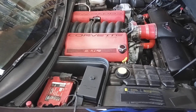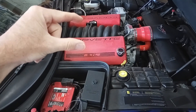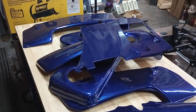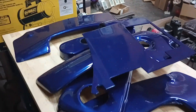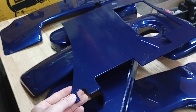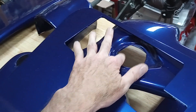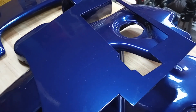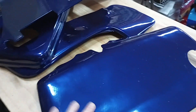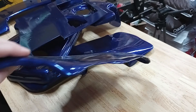In the past couple winters I bought some covers for the engine bay, and then I made three different covers out of carbon fiber — the coil covers and the throttle body. They're missing, and here's why. Unfortunately the vinyl on the panels I bought really has not held up very well, and it's not the flat surfaces, it's the wrapped edges. I'm having a lot of delamination around the edges where the adhesive just isn't holding up to the heat in the engine bay. The flat surfaces are just fine, but you can see all of this is starting to peel away. The Corvettes can run upwards of 230 degrees Fahrenheit, and even thin carbon fiber isn't going to hold its shape. This should be curved and it's pretty much straight.